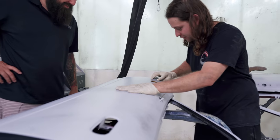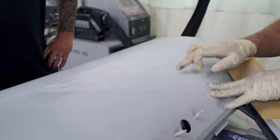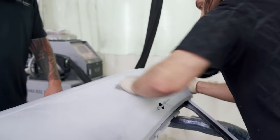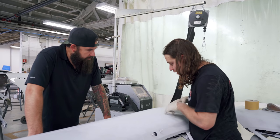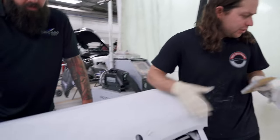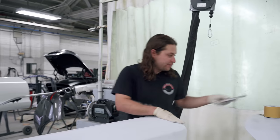And then you would just block it like this. This is probably one of the bondo spots — you can kind of see it, there's a ring. And I like to just do like an X motion. How do you know when it's done? I'm going to make sure everything's all light gray. So I cut all that down. I'm even going to feel it. I know this door — there was no bondo. This one was pretty fine, but we're still going to block it. This one had a couple of primer spots.